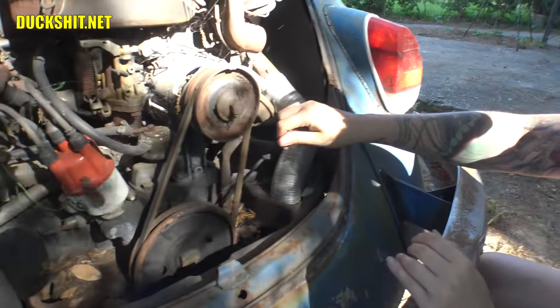Most Volkswagens have a tar board — like sound dampening or the Dynamat stuff you see nowadays. This carpet wraps all the way around. You want to look along the edges for rust. Actually, you know what, this floor might actually be in good shape. There's a rust here in the A-pillar that we discussed earlier. I'm squeezing the heater channels along this way and they feel solid — that's good news, that's really good news. It looks like the floors might actually even be intact. I'll have to pull the screws out of that kick plate for the passenger footrest to look underneath for any more rust. Let's see if we can flip that seat forward. There's our hubcaps — good news on that. And a book about tattoos. This is the side where the battery lives. Oh, there's rust through the floor. Okay, that's what I'm expecting.